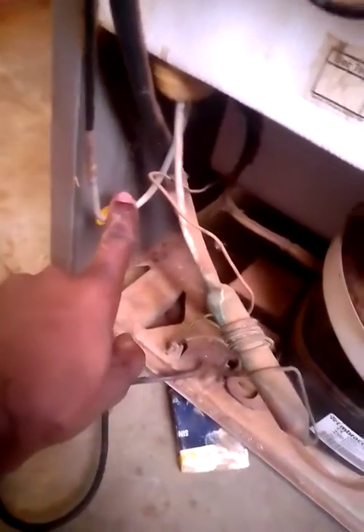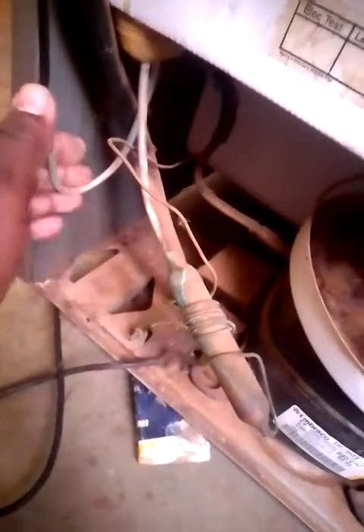What I'm going to do right now is change this filter dryer — every time we charge the system you have to change the filter dryer. I also have to cut the door condenser here. The refrigerant goes inside the condenser, out through the capillary tube, then to the filter dryer. We're going to cut here and put the filter dryer right here, because mostly this door heater condenser is the one that starts to leak first. Then I'll put the charging valve, run it to see if it goes into vacuum to check the compressor, then replace the filter dryer and recharge the system.